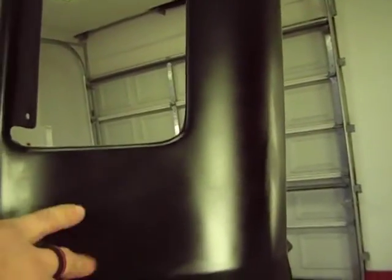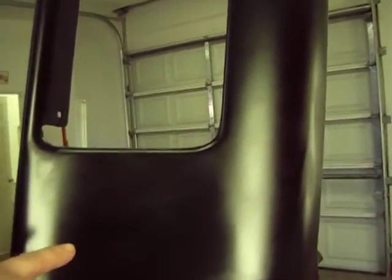So I got to looking at the panels and got a magnifying glass out so I could really see these pops. You guys saw I used a little bit of filler, glazing putty, here and there to go over some of the areas that were low or had some imperfections. And I got to noticing that anywhere where I had put that glazing putty, there was no problems. But then you come over where there's no glazing putty and it started the popping deal, as you can see. And here's some glaze, hopefully that's showing. Right in there, it's all glazing putty, and then as you come over, boom, it turns into this ugly mess.